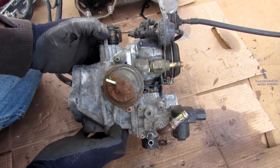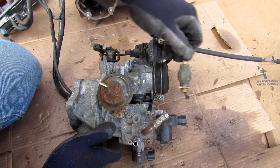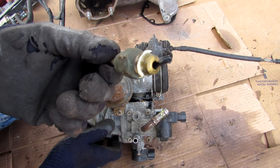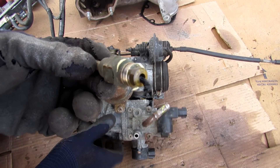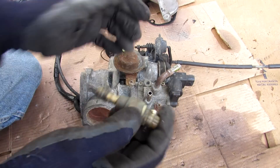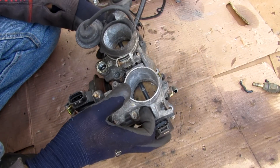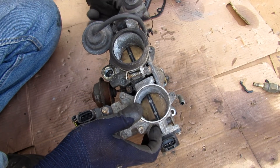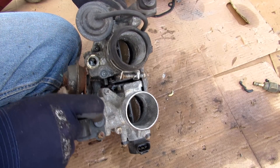Taking a quick look at some of the other technology on the throttle body side — starting with this little check valve that screws out. You can see there's so much sludge on there, so make sure you change your oil. It's actually just a through-valve — a connection point for vacuum going into this part of the throttle body. The throttle body controls the amount of air going into the intake plenum through two butterfly valves inside.